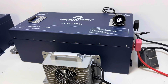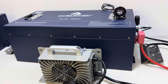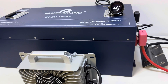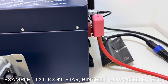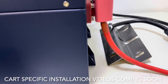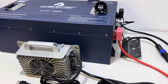In regards to mounting the 150 Amp-hour battery — it is a very large and long battery, and for most carts you're going to have to do a little modification. On an RXV you may have to modify the plastic tray, and in a Club Car Precedent you may also have to modify the plastic. Some people use the mounting brackets and some mount it directly to the bottom of the battery tray. If you have a metal frame tray, you drill your mounting holes and nut-and-bolt it down. The mounting feet match up with the holes on the top of the mounting bracket, you nut-and-bolt those down, and it's a very secure mount. This installation kit is universal across all three batteries.